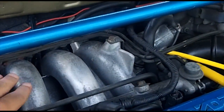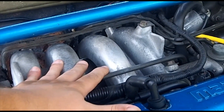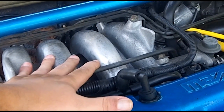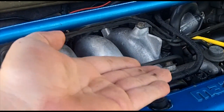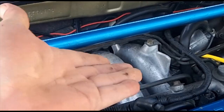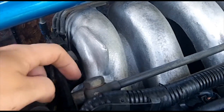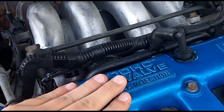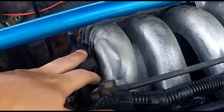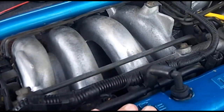All of the air is being sucked in here, and along with that suction, I don't know the exact calculation of how much pressure is being sucked in. I can get that number for you. It's right here. That much PSI or kilopascals or whatever in pressure is being sucked in. That will also suck in the fuel vapor. As long as your cylinder compression is good, you don't have to worry about suction. The solenoid valve, none of these solenoids make suction. The only thing that makes suction is your engine.